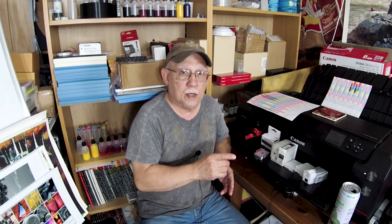With the Pro 100 and Pro 10, no problems whatsoever. But there's always a catch — try to find one in this day and age. They're almost extinct. We have a Pro 200 that just came out that replaces the Pro 100, and a Pro 300 that replaces the Pro 10. Same number of colors, same print heads — identical print heads — and there may be a slight upgrade in the inks. The problem is there's no resetter. RedSetter, the company that creates these red resetters, is currently working on it. We'll see what happens.